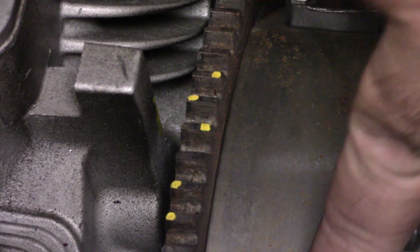All right, we are almost right dead on — pretty close to being dead on. Yeah, I'm happy with that. It's 32 degrees. The reason I use the timing light is because these flywheels are known to not be real accurate — they're just a good starting spot. So knowing that we're right on with the timing light, I'm very, very happy.